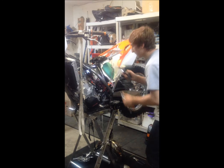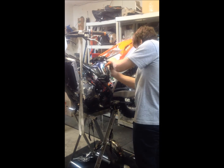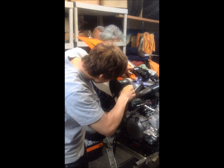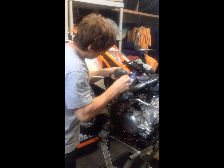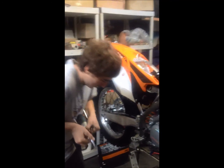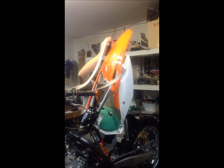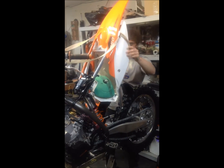To get to the bolt, I must remove that. You don't have to remove the top bolt all the way. Now you can go over to this side and take the bottom one out again. Fairly easy to remove. There. Slack the top bolt a little. Remove the tool, and then lift the subframe up. Tighten this over here. So now that should hold up fairly easy.